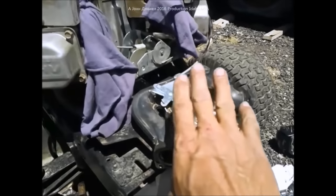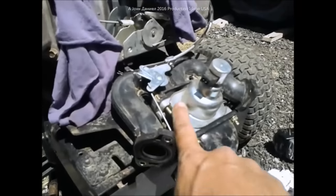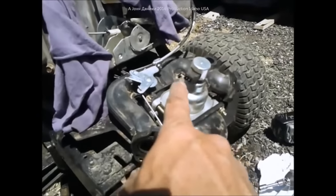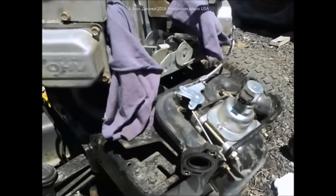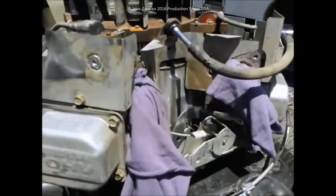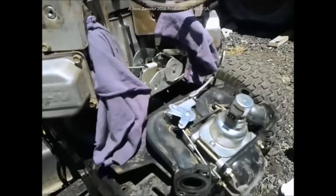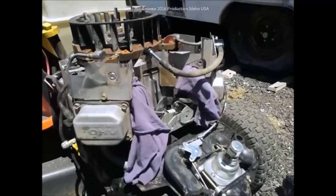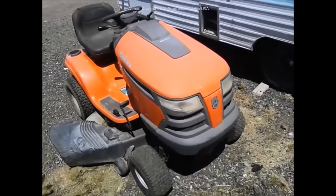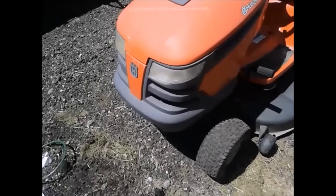This is the typical restore you're going to do on a Briggs and Stratton Intek motor — a lot of them use this same carburetor setup. The kits can differ slightly, but this is 99% of the time your problem. Don't forget your governor, because if you do she certainly won't run right. Do it yourself and save your money — right from surging to solid. Listen to her now: sounds smooth. It was hunting like crazy, wouldn't run right — now there she is.